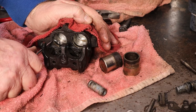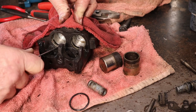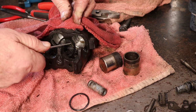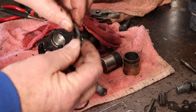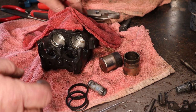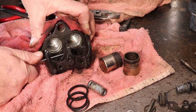These outside ones are usually the culprit. What's happening here is brake fluid with age gets in here and it crystallizes like that. When it does that it grows in behind the O-ring and pushes the O-ring up harder against the piston, and then it can't work right. These seals start to fail when they get really hard, and that's what lets the brake fluid out. These square ones are pretty crusty too on the outside edge - fluid slowly migrates past those when they get old, they get hard and just leak, getting underneath that other O-ring and binding it all up.